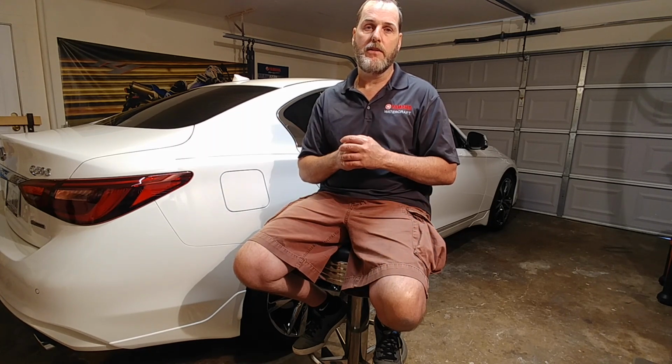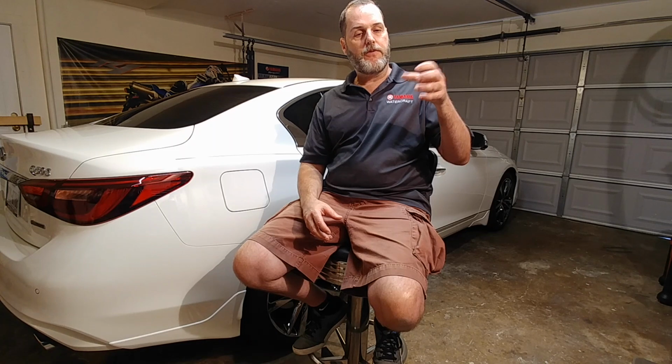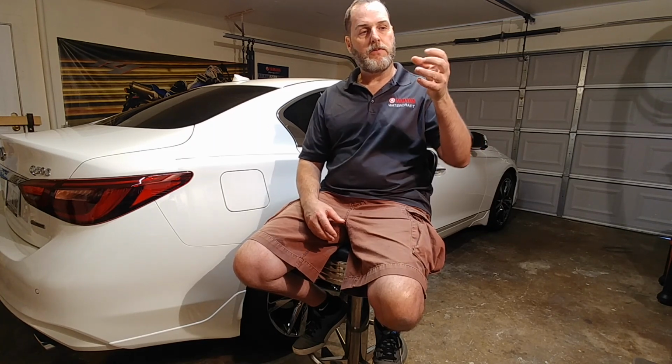go and it shakes the interior of your car and your transmission, and it can shake your suspension components. It can get to where it's bad enough that you can damage stuff, and you can really damage the rear end. For people that have a lot more horsepower and more rubber on the road, like on a track surface, that's when you'll see the drivetrain snap and break and the components fail. Not necessarily in a 400 or 500 horsepower car, but as the differential is loading up and releasing, loading up and releasing, then the suspension starts to hop.